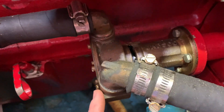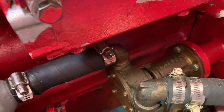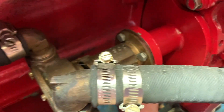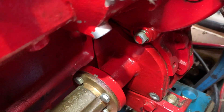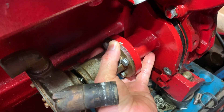Anyway, ordered a new pump. Going to remove this one and get the new pump installed. It's a matter of three bolts — one down here, one right back in there, and another one just visible right back here. Shouldn't take too long. Got the fasteners out and gave the pump a couple of gentle wraps with a mallet to get it loose.